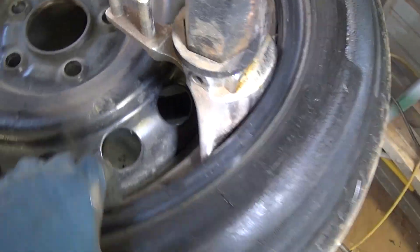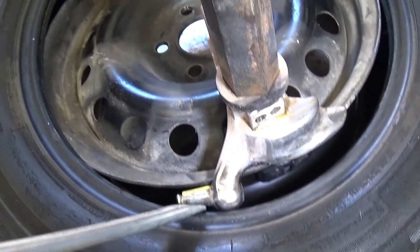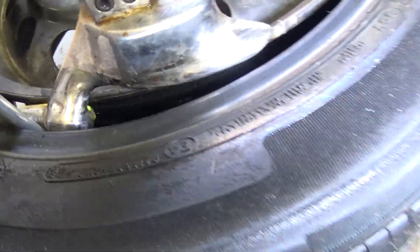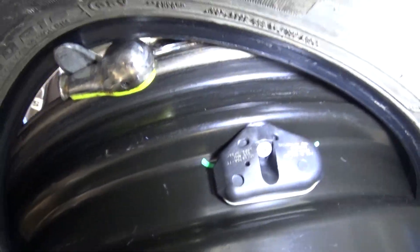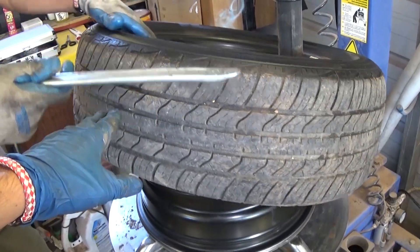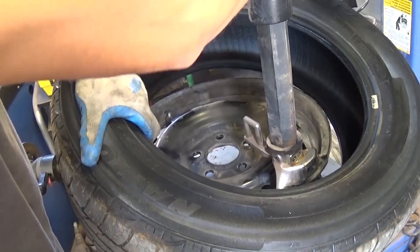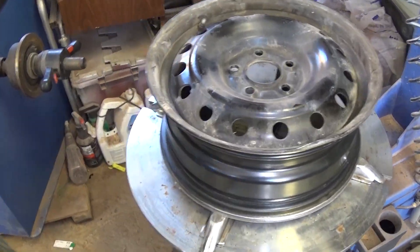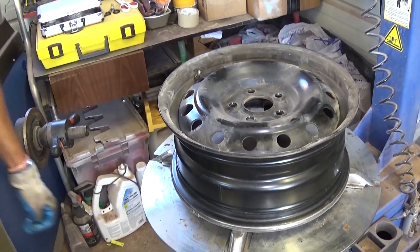You need to make sure that the valve stem again is right before the point we're picking. That's very, very tricky. You need to get to the bottom bead right there and make sure it doesn't catch the sensor. The sensor is safe — you can see like that. We're gonna go ahead and pull it out now. We're halfway done — we took the tire off. Usually that's the most dangerous thing with those sensors; that's when people break them. Installing the new tire will be easier — stay with us.